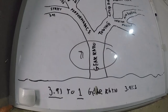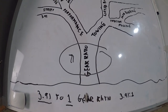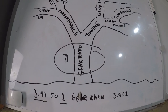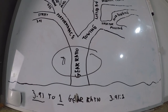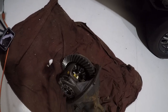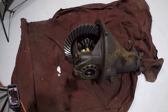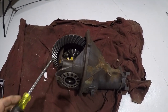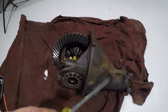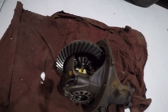There are three different ways to figure out what gear ratio you have in your vehicle. The first way is if you have the third member out, or if you have the inspection plate off the back of it if it's not a dropout third member like this. You can figure out your gear ratio by counting all the teeth on the ring gear — put a mark on one of the teeth, count them all the way around, and then count the teeth inside the pinion. Divide those two and you get your gear ratio.